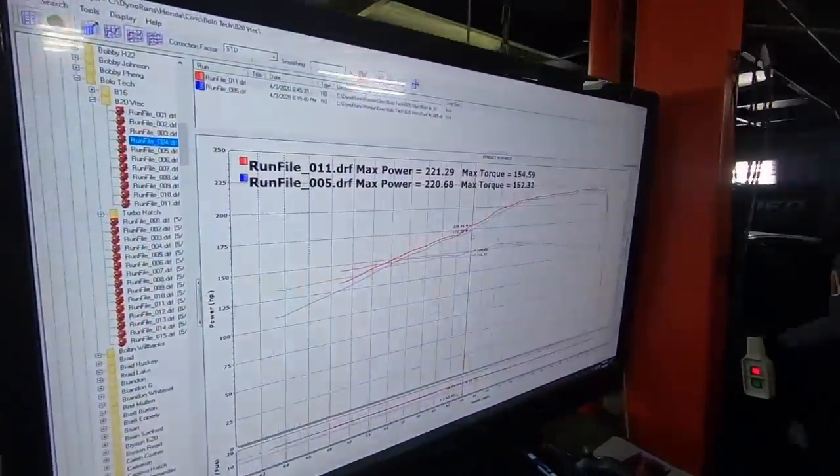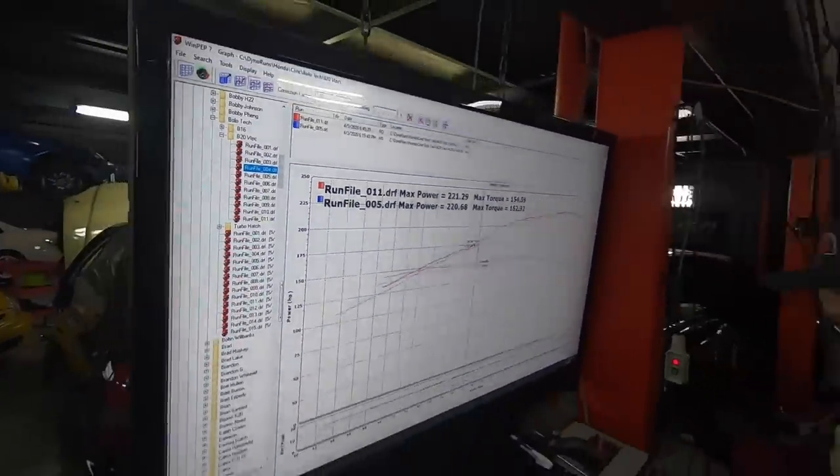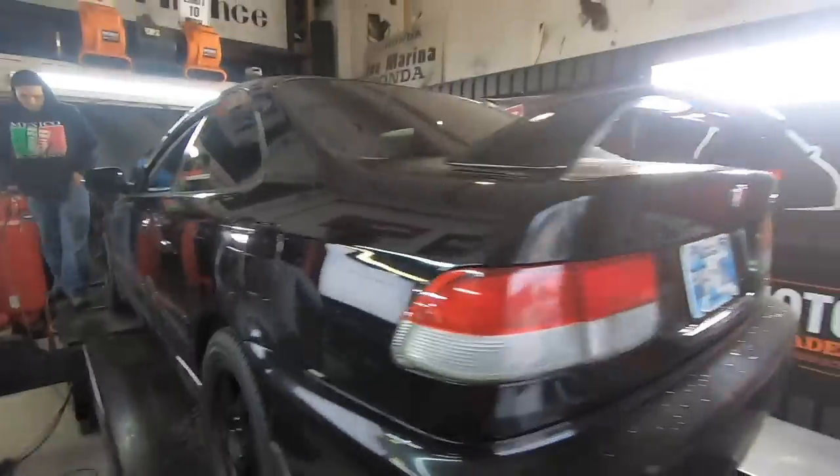That's why the K series is kind of at an advantage. With the mechanical cam timing differences, you basically are able to adjust the bottom end or adjust the top end by advancing or retarding the cam, and it just sits there. That's where it is permanently the entire time. On the K series, that is dynamic and changing all the time.